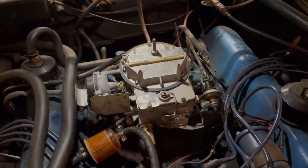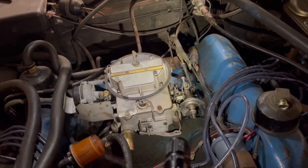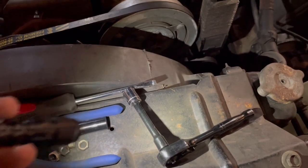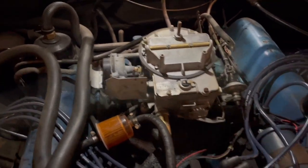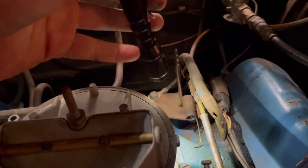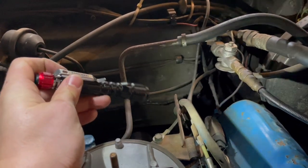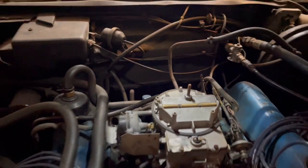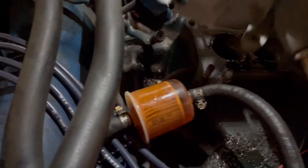Got all of the nuts off — those aren't too bad. This one's a little tricky just because the accelerator pump linkage is in the way, but if you get a thin 7/16 socket on a quarter-inch drive you're going to be fine. All the nuts are 7/16, the choke heater is half an inch, and then the vacuum hoses are just the vacuum hoses. The accelerator cable rolls off; you'll have to remove the return spring and disconnect it. This is for adjustable accelerator pedal tension — you can move the spring further back at each of these little steps if you want more tension. And that's it — it's ready to pop off, and there we are, we're free.